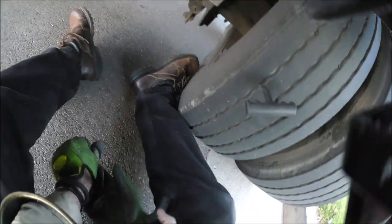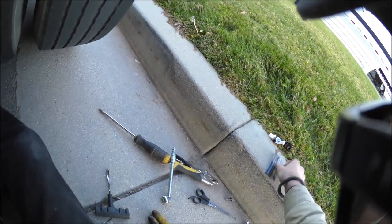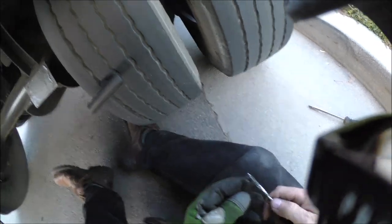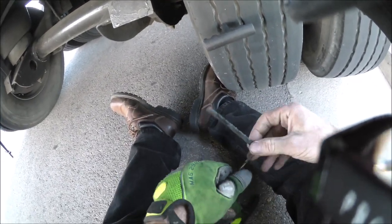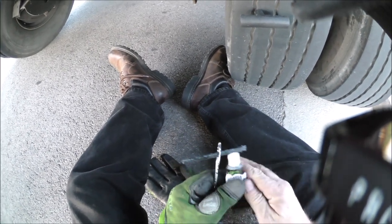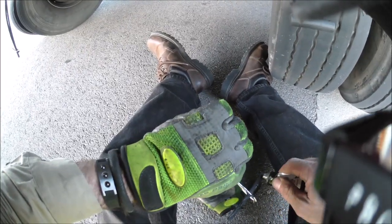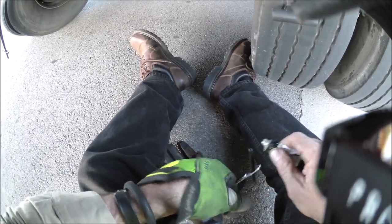The main thing is pushing that through and getting through the tread so it doesn't get clogged in your plugs. They sell these plugs in all the parts stores, in the auto area - even Walmart has these. Let's put these in and slide it in real good. And don't forget your rubber cement. Once you apply it, in about a half an hour all this will be cemented really good, and then you can guarantee it to the life of the tire.